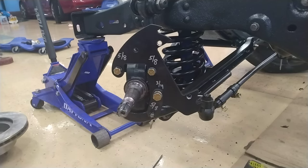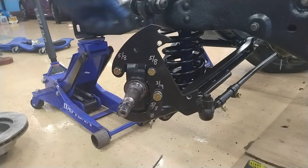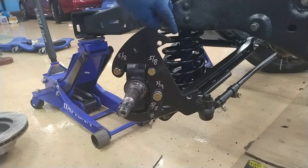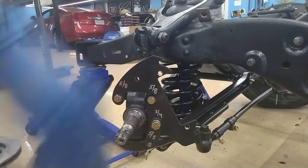All right, so this is a front disc brake kit for a 1956 Cadillac, and this is pretty straightforward. I, on the other hand, am mirroring this. So as you can see, this is the orientation that I'm putting it in. The directions actually say to flip it the other way, but I'm going to be putting it this way. That way I actually have enough distance for the brake hose to get back up to the bracket holder on the frame right here.